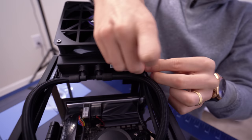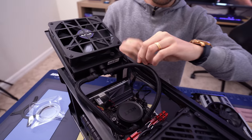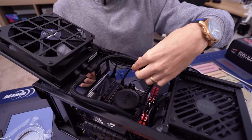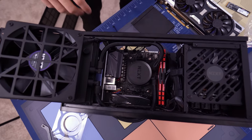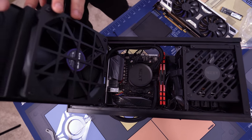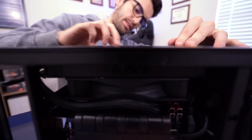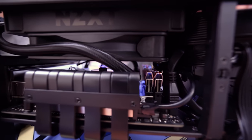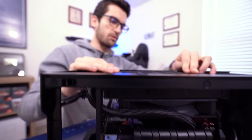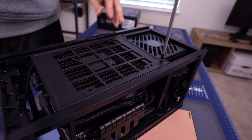Remember, this entire little subframe needs to fold almost 180 degrees, so you don't want any kinks in your cabling. You obviously want it to look somewhat clean. There's actually a pretty good amount of space, but it's going to be taken up when we fold this over. Watch the AIO tubes — you really don't want to kink those up. That is one tight fit. Nothing really kinked over here, though the clearance is awfully minimal. Don't forget to secure this folding subframe with the two screws you removed earlier.